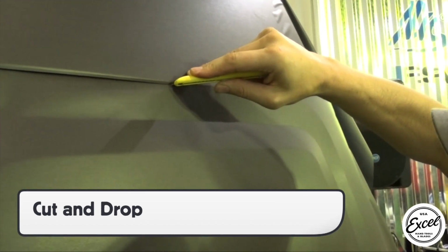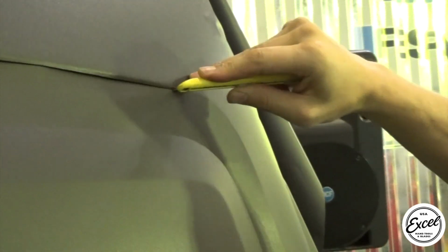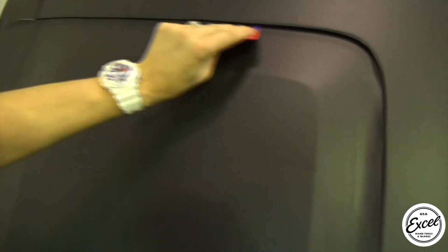The wrap film is applied over the entire door with the film bridging the gap, and then it's cut and dropped. The film is then squeegeed into the recessed area over the inlay strip, and a finger and a squeegee help seal the deal. This creates a paint-like effect easily, and it can be done on location, which is key.